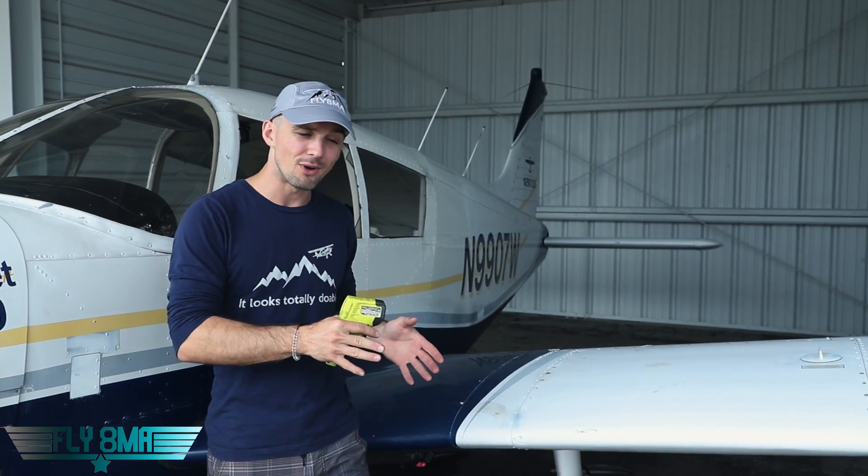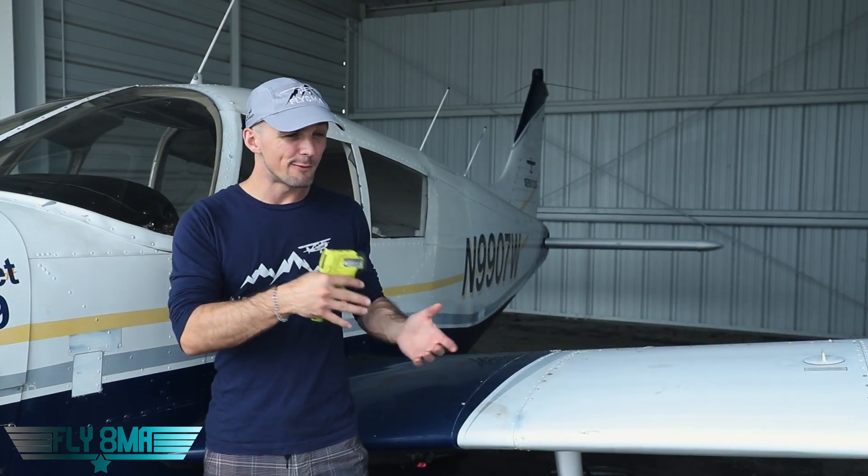All too often I'm seeing students apply brake rather than reduce power when they're taxiing out to the runway. There are a lot of other times students are really hard on brakes, and we routinely see brake changes on trainer aircraft being 100 to 150 hours. On my personal airplanes, I've gone 500 to 600 hours without actually changing the brake pads ever — no need for it, they're not wearing out, we measure them and they look just fine. On trainer aircraft, they're getting worn down way fast.